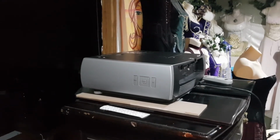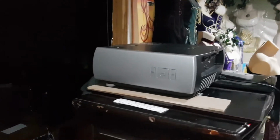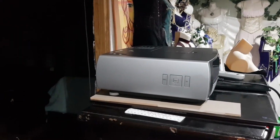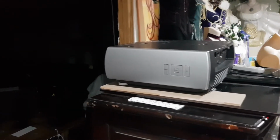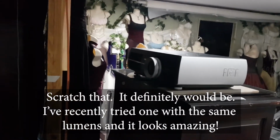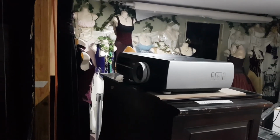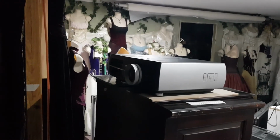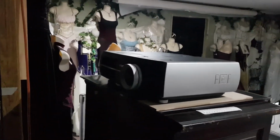these projectors are incredible. Apparently this projector cost about $4,500 when it came out in 2010, full 1080p. It's got vertical and horizontal lens shift and your zooms and all of that kind of stuff. Even if it did work though, it wouldn't be bright enough to light up that 170-inch screen that I have down there. But it would be good enough for me to use temporarily until I got this whole cinema sorted and get a decent projector to light it up. I think it's only 1600 or 1500 lumens, but I think it gives you 15 foot-lamberts of light on a 170-inch screen if it's 0.7 gain, which is what this temporary screen that I'm going to be building will be.